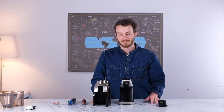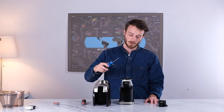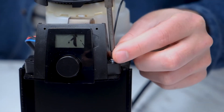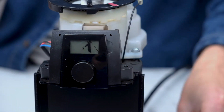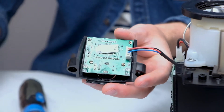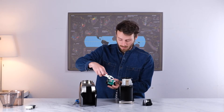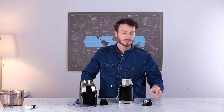Now that the case is removed, it's pretty much smooth sailing from here. Go ahead and grab the T10 screwdriver and work on getting the screws off of the screen. Once you have taken those out, grab the pliers and unplug the Molex connector from the back of the screen. This is what both gives power to the screen itself and also the lights that light up your grounds bin. Be careful as you wiggle it back and forth while unplugging it. Once that's unplugged, set the wire off to the side, set that broken screen off to the side, and let's grab your new screen.